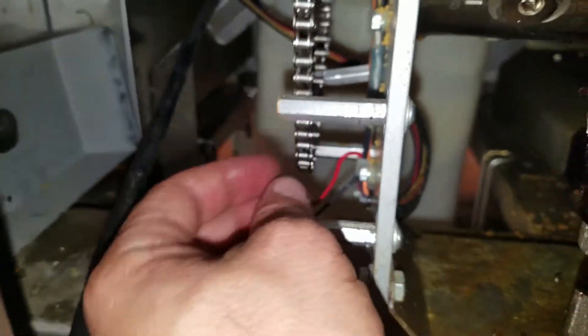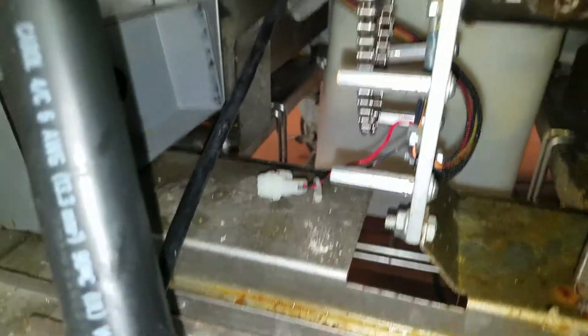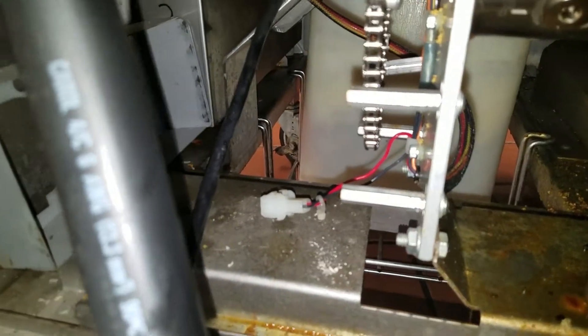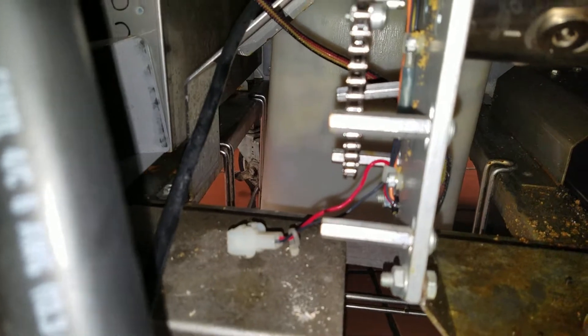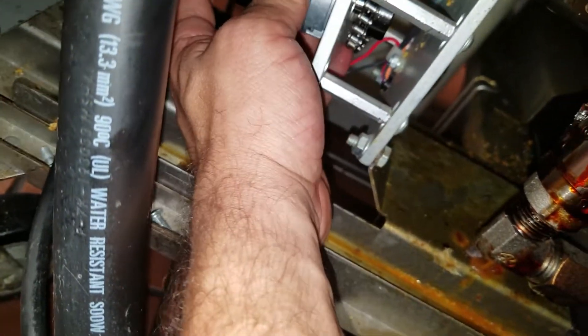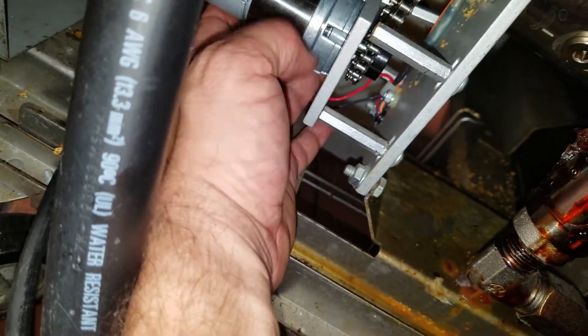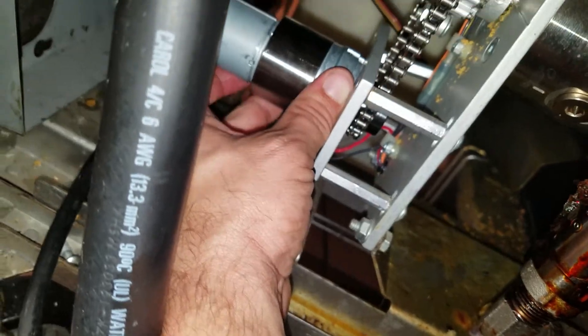The old one's off. If the screws give you a problem, you may need to disconnect them off the old motor and reattach at the new one — it's just an extra 30 seconds to get it lined up. The new motor is really simple to install: get the chain on the sprocket, then line up the mounting holes. You can turn it by hand slightly to get the holes aligned, then put the screws in and plug it back in.